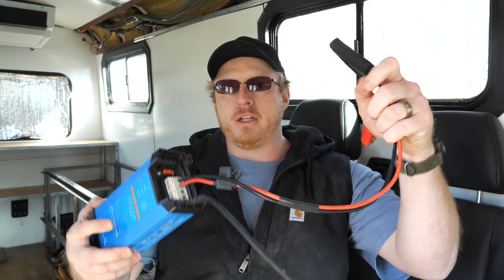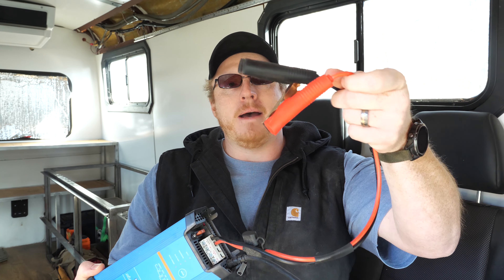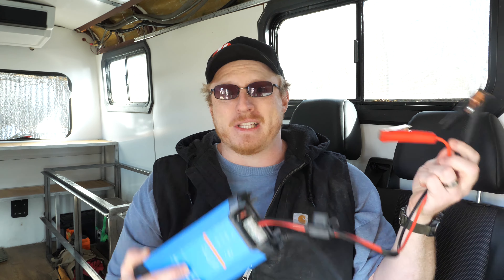This Victron has three outputs, however you cannot change the profile for each one. It's a smart charger — you change it from lithium-ion to lead-acid via the app or the button on the front. The problem is I can't hook it up to both my starter battery and my house battery at the same time. I've got a small lead with 10 gauge wire and decent clamps — when I need to charge my truck I charge my truck, and when I charge house batteries I charge house batteries. I just use it as a portable charger.